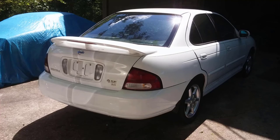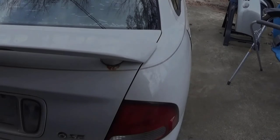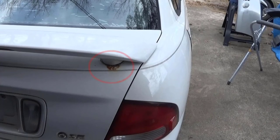I think I took 180 and went around and knocked off the rust, and then I used a rust converter spray. And again, I'll put these chemicals down in the description for you to be able to use them. I knocked it off, sprayed that on, taped off the trunk right there at the pinstriping and just masked off my little area around that.